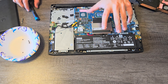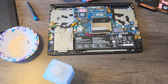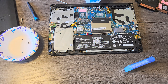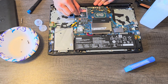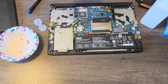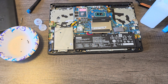I'm going to dust this out anyway, just to get any dust out of the motherboard. But first, we're going to clean off the CPU and GPU — that's where the Q-tips and alcohol come in. Take a little bit of alcohol, put it on your cotton swab or Q-tip, and use that to clean off the CPU and GPU. Make sure to get all that thermal paste off. You may go through a few Q-tips doing this. Some paper towel can also help to clean up any loose bits of thermal paste. Be careful not to scratch anything, and don't use a paper towel that leaves a lot of dust particles. I also recommend just dabbing it with the paper towel. The hardest part is just getting in those edges.